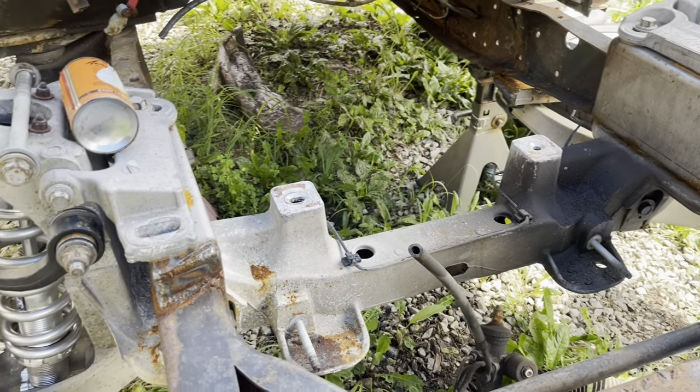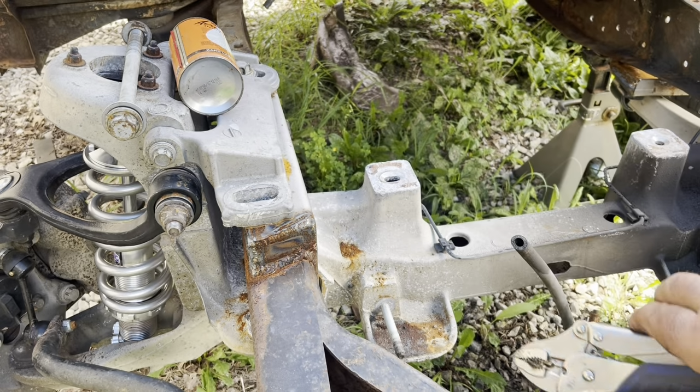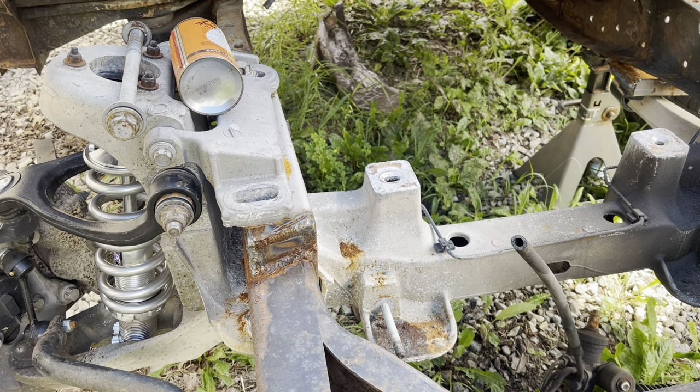Okay, so I've looked a little bit for an 8mm. That's what that end is there on the end of the stud right here. It's an 8mm 6-point socket on a 3/8 drive. Without really digging through a whole bunch of stuff, I don't quite have one. So I've come up with a new plan. We're going to run the original big nut back up on it, and I'm going to take this pair of vice grips and destroy the threads and permanently lock it on there. We're throwing it away anyway. While I get all that ready, I'm going to heat the thing up with the MAP gas. I've found it, and I'm going to heat it up real hot and see if we can get that one out. The other one I think might come out easier, just due to all the oil and grease that was already on it. So I'm going to start the heat first and see how it goes from there.